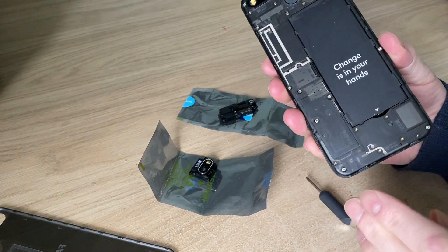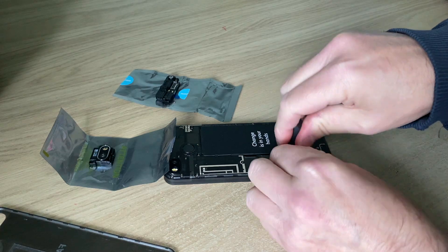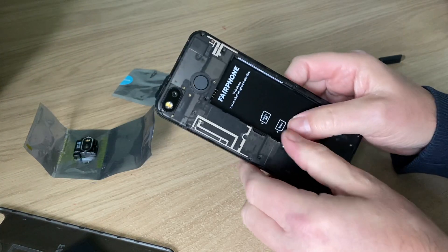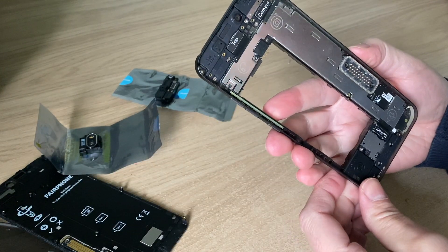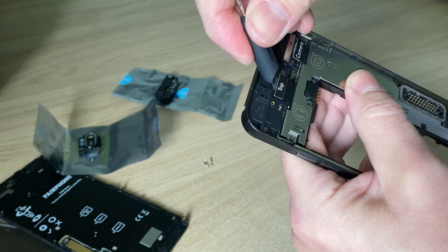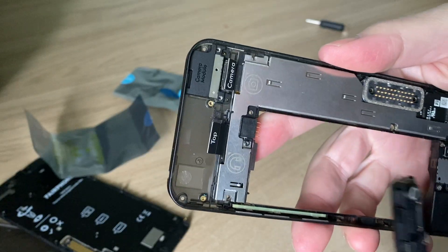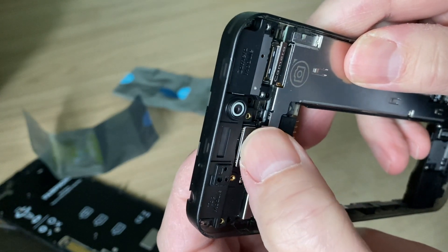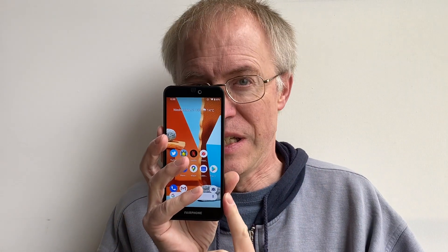So, as promised, we peel the back off. There's the battery, which can be replaced in seconds with a charged spare — yes, you can buy batteries on the Fairphone website. Undo the dozen little crosshead screws with the screwdriver provided. This is a bit fiddly, but it takes just a couple of minutes. The display then pushes off with a click — just in case it was broken and you needed to replace it; it's 90 euros on the Fairphone site. Now we see the various modules. In each case, undo a couple more screws, then use the reverse spatula end of the included screwdriver to lever off the ribbon connectors and lever out the modules themselves. Then just put in the new modules, reversing the procedure. Display snapped back on, all screws in, back on — job done.